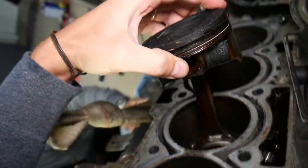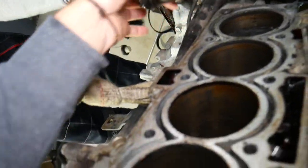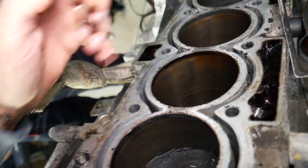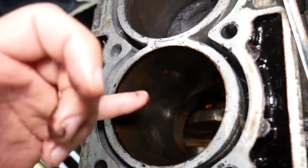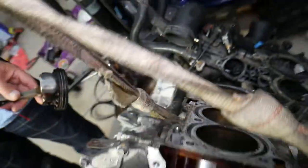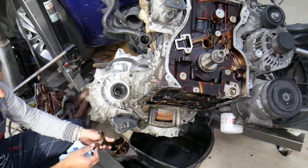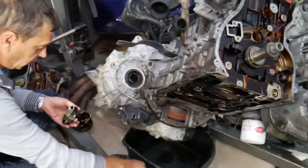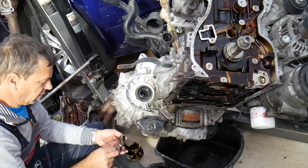The piston with connecting rod comes out. Bring it down and gently clean the carbon buildup, as the rings will have already removed most of it. You can see this piston was starting to wear out — it's developing piston slap. This engine will need to be fully rebuilt with new pistons, new bearings, and the crankshaft resurfaced with oversized bearings. That's how you remove pistons on cylinders one, two, and three. For cylinder four, you need to remove the bottom crankcase — we have a video for that on Hyundai Elantra. Thank you for watching!